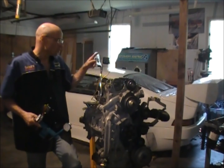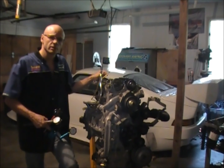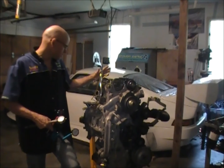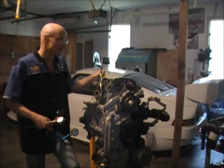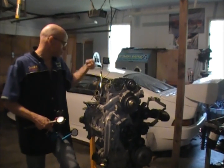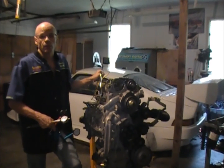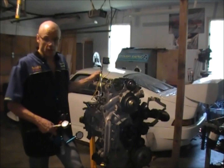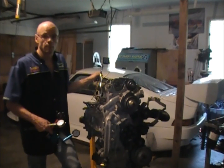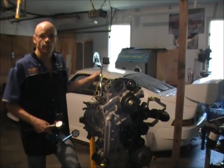The first step is what we've already done, and that is to mount the digital degree wheel, our DigitX. That's done and it's already mounted. We will show how to set up for top dead center with that, but before you do, you need to set the tool up — we'll show how to do that in another video. For now, it's done. The first step from here is to go ahead and mount the top dead center indicator and the SR090 GT3 cam timing apparatus.